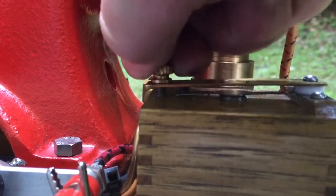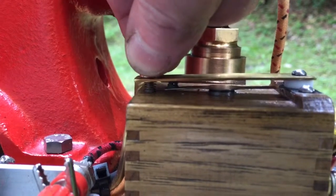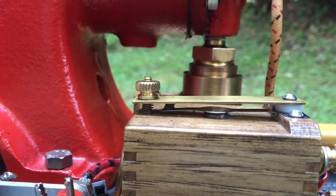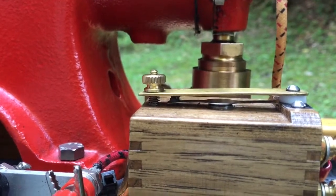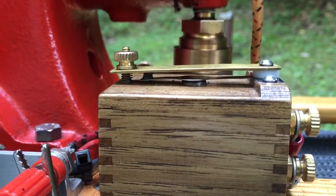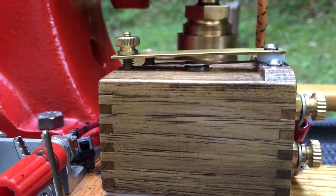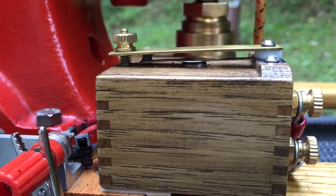If you turn it in too much, it's going to stop. Since this is a scale buzz coil and it's kind of small, it can be a little finicky — finicky is the word for this motor. You can pull the plug out and ground it to check spark. If I touched the wire right now, I'd get zapped. When the points close and complete the circuit, it should sound right — if it doesn't, you're not going to be getting any spark.